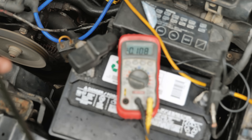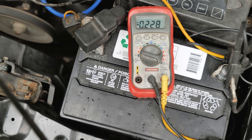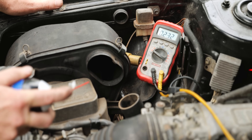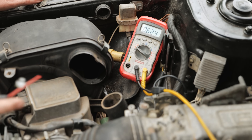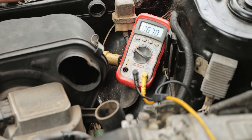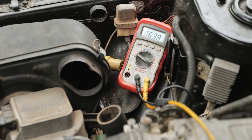What I want to try is to see if we can make this happen again — when it's real, when it drops and starts stalling, I'm going to give it some fuel. If I hit that, it should jump to 0.8. It's stalling the engine out and it only went to 0.6 — that's not enough. That sensor is garbage just from that standpoint alone.